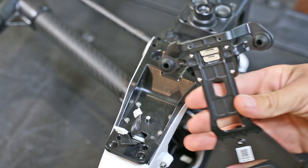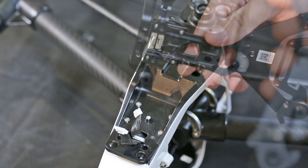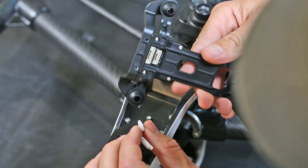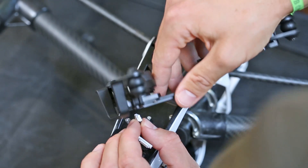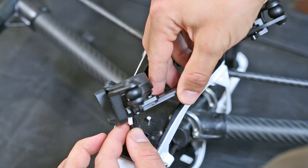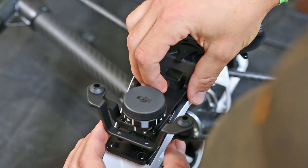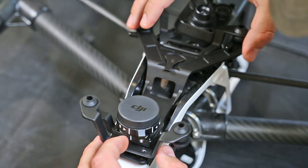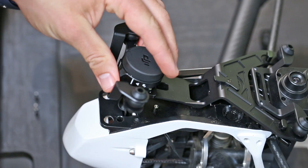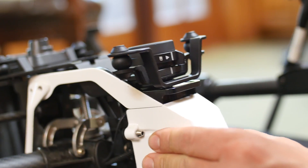That's going to go on just like that. There's an individual plate that wobbles against these anti-vibration rubber parts — there's a slightly smaller one and a slightly larger one. You've got to make sure that the interlocking goes facing forward; as you can see, it's got a little slot right there. We're going to plug the smaller one into the back end — you heard it clip in — and the front larger one into the front. You heard that snap in as well. So now these are both connected, and these two holes will line up at the front, and the back will line up at the back. Now that we have our wires plugged in properly, make sure the wires are tucked back inside without bending or creasing them too much — they should already be slightly creased in and sit there like that.